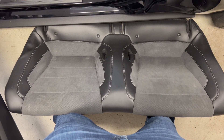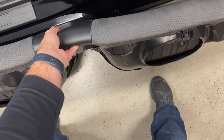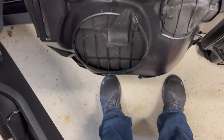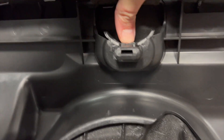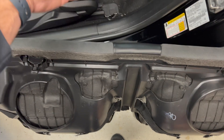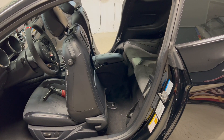Here's the butt portion of the rear seat. I wanted to show the release mechanism before getting into the full procedure. If we turn this over, the only two places where the seat is held to the chassis in the front — where there's a release — is right here in the middle on the driver's side and on the passenger side. You'll reach your finger right through there and push in on the center. As you push down and depress that, this little latch will go down and allow the seat to pop up. You do one side, then the other, and then slide the seat out.